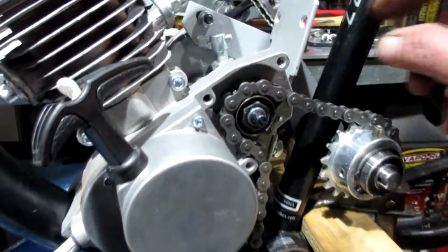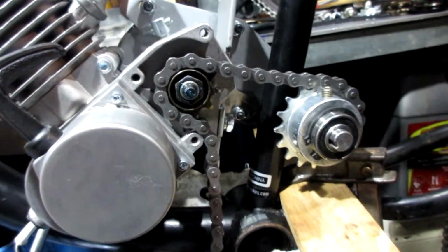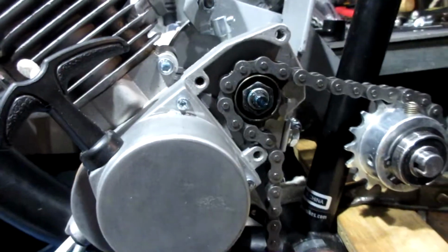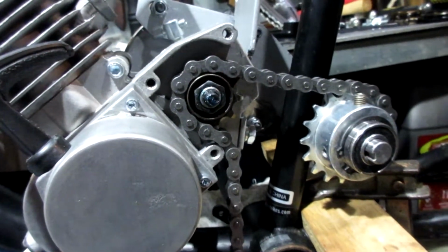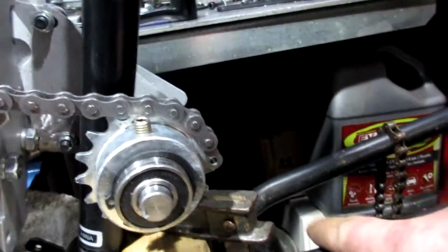Yeah, there's going to have to be some kind of spacers between here and here, like bigger U-bolts, longer U-bolts I should say, and maybe stacking up washers, which is kind of cheesy. Maybe cutting some tubing. That's what I'll do, I'll cut some tubing. I want to keep this shaft as close to here as possible because the tire passes through here.